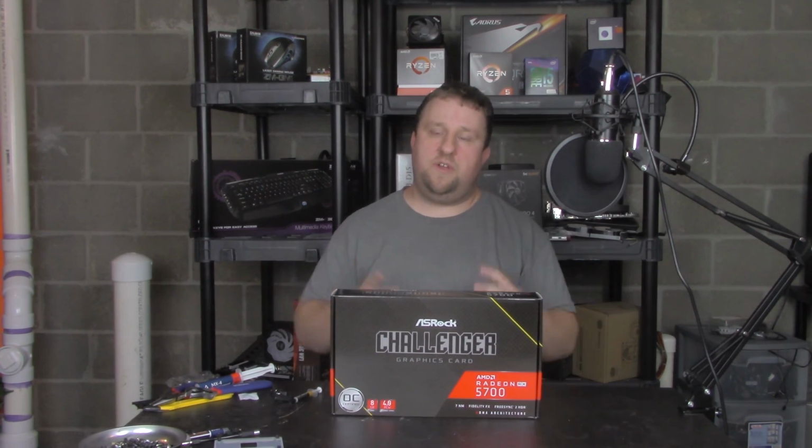So there it is. I kind of wish I would have done this before, but now that I got the results, I'm happy I didn't, because they were taking a lot longer. But I'm very glad to see that even on these RX 5700 cards you can get better performance by overclocking as far as AMD is going to let you, as well as reducing the voltage to reduce thermals. And that's just never a bad thing. Running cooler is never going to be bad, as long as you can get it stable.